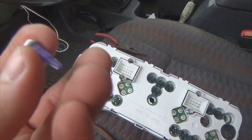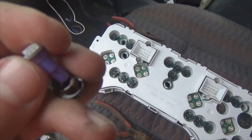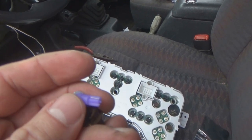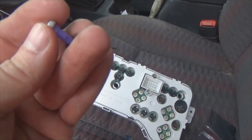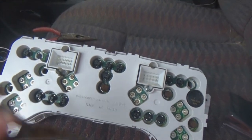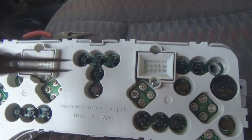Here's the little LEDs we're putting in. Remember, as I mentioned earlier, these things are polarity sensitive. What really is tricky is I can't tell you to put it this way and it'll work first time — it's a trial and error thing. They simply slide in. What you want to do is look at the positioning of the wires. The wires have to be on the side of the little plastic encasing. If they're on the end they will not make contact — they've got to be on the sides. Whenever you plug them in, they just simply slide in like that. Then you put them in and lock them back in. You don't have to put a lot of pressure to them, just enough.